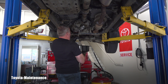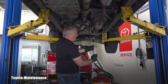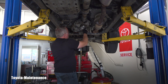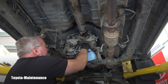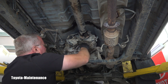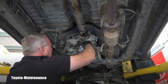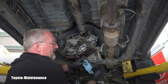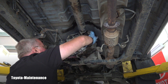I put one quart and it's very slightly overflowing. I'll use this syringe and pull just a tiny bit of that oil out. What did I take out? Almost nothing — less than 0.1 quarts. That can go back in. When I put my finger with my glove all the way touching the threads, it's completely dry. If I go down a little further I'm touching the oil — you can see how shiny it is. Confirmed: I have enough oil there.